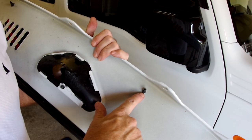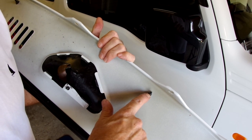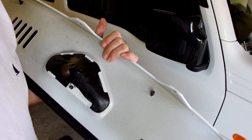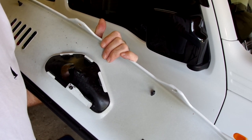Then we have to do the same on the other side. As you pull this off from the front of the car, you need to disconnect the washer nozzles. Also, it's quite a tight fit between here and the bottom of the bonnet so use some foam pads and cloths to protect both this and the bonnet itself.